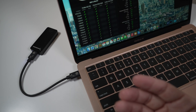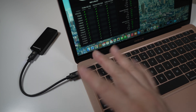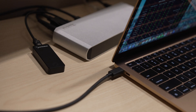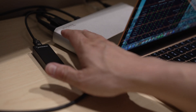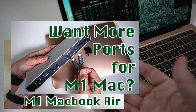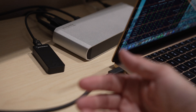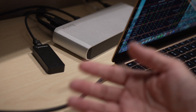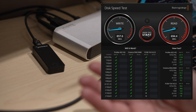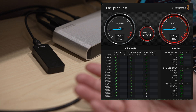By the way, even though the USB ports on the M1 Mac are spec'd up to 10 gigabits per second, they're slower than those on the Intel Mac for some reason. The workaround is to connect the drive through a Thunderbolt hub with 10 gigabits per second USB ports like the ones I've reviewed before — I'll put links to those videos here and in the description. Going through the hub, I can get about a 40% increase in transfer speed from the Rocket Nano, at around 850 megabytes per second write and 920 megabytes per second read — even more improvement than what I've seen with the Samsung T7.